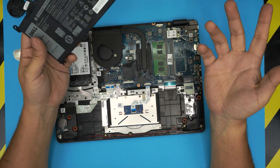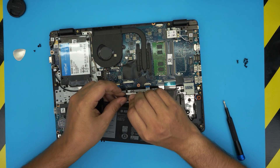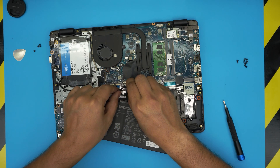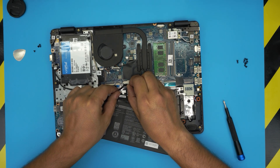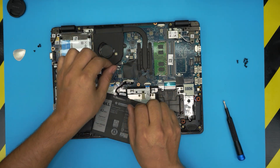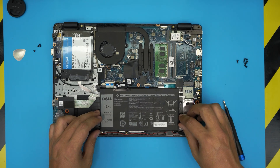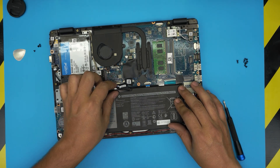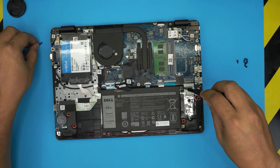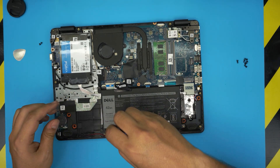That's your battery — it's a three-cell polymer battery. When installing the new battery, grab the jack, make sure it's lined up directly in front of the connector evenly, and push it towards the motherboard — don't go sideways. Put the tape back over it, align the battery in place by the screw holes, make sure all cables are nicely tucked in, and put in the four screws to hold the battery in place.